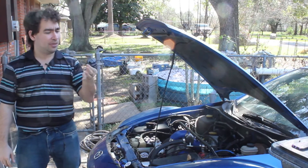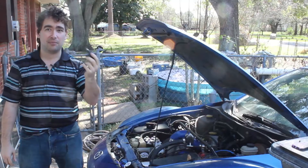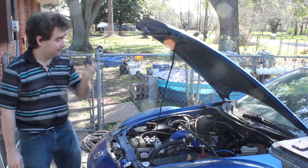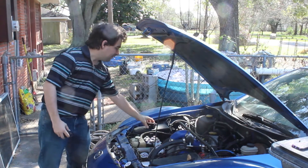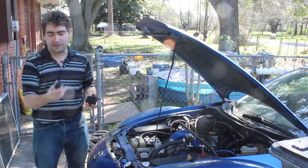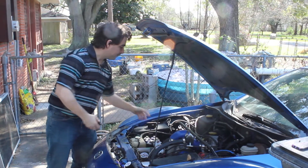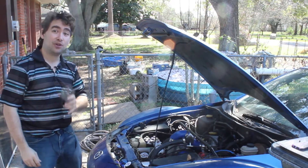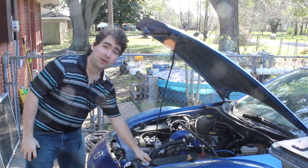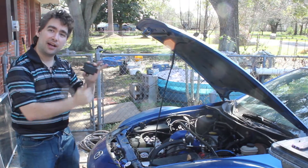Even before that, I played with these. This is an ignition coil off an Isuzu Rodeo. While I can make it spark and I can read ion sensing data off of it, the dwell time is incredibly different from stock — five milliseconds versus less than one millisecond. It doesn't work. But I found a trick: the coils I have now, which are this ignition coil without the internal igniter and with no diode.